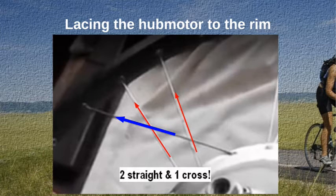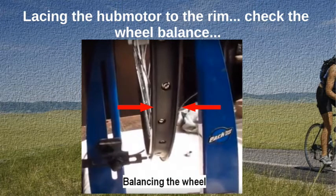Sometimes there is a third hole next to the two holes — the spoke of the third hole will cross these two spokes. The spokes are then attached to the rim with nipples, which are screws. Once all the screws are tightened, the wheel must be spun to check for any wobble or bend to one side, and the screws adjusted accordingly.